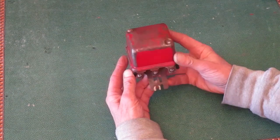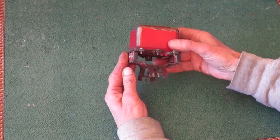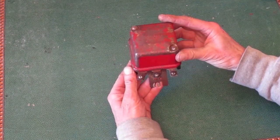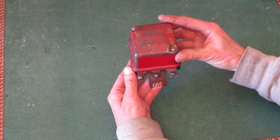This one has the curved mounting, so it mounts on the starter generator. There are three terminals coming out the front. The left one is marked L for lights or load, where you would connect your lights and other electrical devices. The middle one is marked BAT for battery, and the right one is marked F for field. It connects to the F terminal on the starter generator, which goes to the field coil.